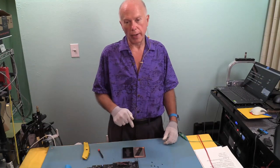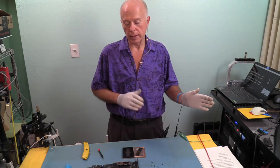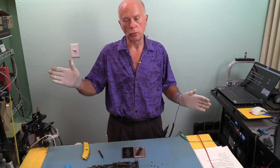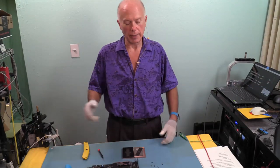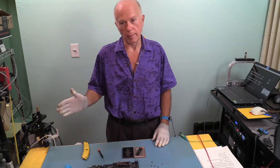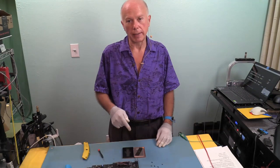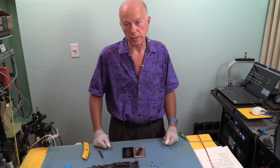There's two ways to do RAID with one of these cards. One in the BIOS, which is a hybrid RAID. The other way is with software, which is done in the operating system, which is Windows. It's a slower RAID, it's a safer RAID. The hybrid RAID is a bootable RAID. The software RAID is not bootable. But this BIOS RAID can go poof and disappear. So data needs to exist in three places and be prepared.